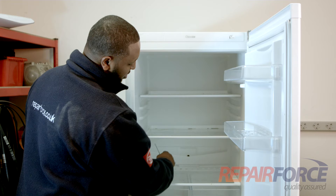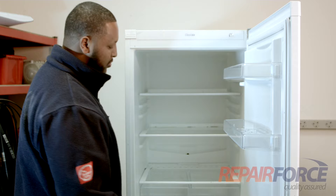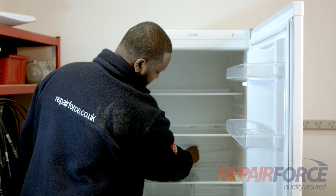The blockage is just here. Ice starts to form up in this part of the region. When it builds up, you've got your fridge built up with ice. Once you open the door you tend to find your fridge is leaking — water on the floor. That's because your drain gully is blocked up.